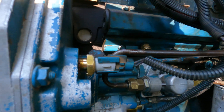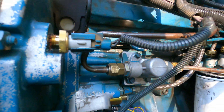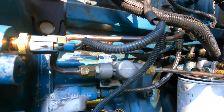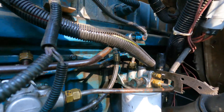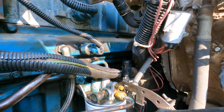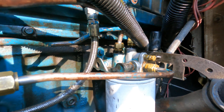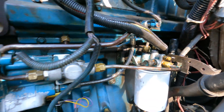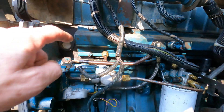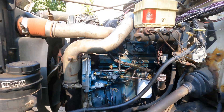Looks like I have a rail leak — I'll have to figure that out. Maybe that's a gasket. We'll take all that apart; they may have taken it apart and not torqued it up when they were trying to fix it. I need to tighten the fuel lines — there's a bit of leakage going on, but not from the one I thought it would be. I'll have to re-torque the fuel rail to see what's up.